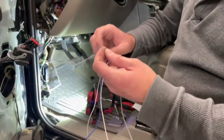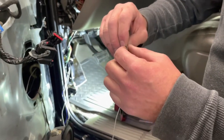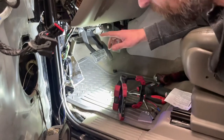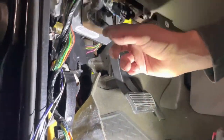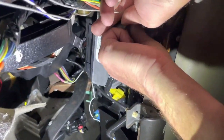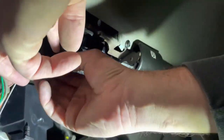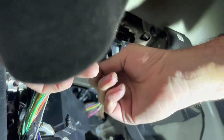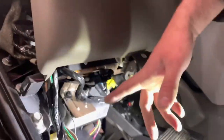As mentioned before, the blue wire is for your white running light, white is for reverse power, and gray is the ground for the reverse light. You can get a ring terminal, crimp it on, and find a clean ground bolt under the dash — there are several to choose from, including the ones holding the OBD2 port. If you don't have ring terminals, you can strip a little extra wire length and wrap it around the bolt instead. Since it's inside the truck you don't have to worry about moisture and corrosion. The ring terminal is the ideal method, but wrapping the wire works in a pinch.